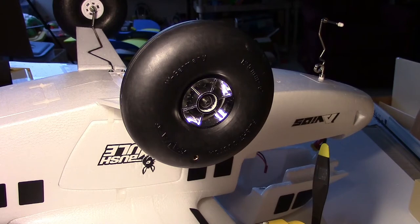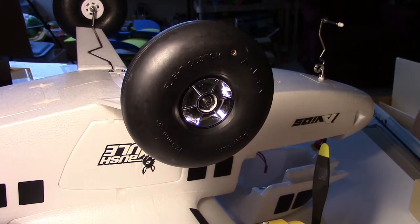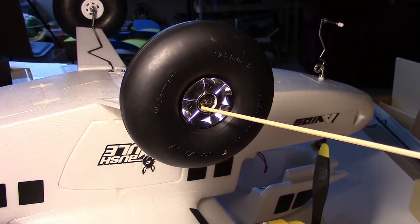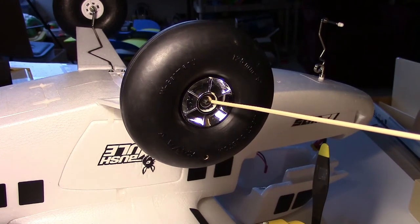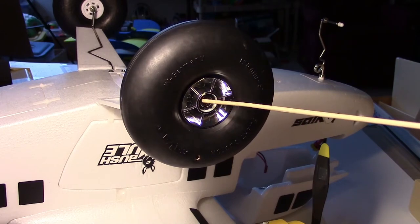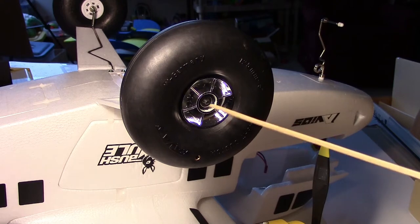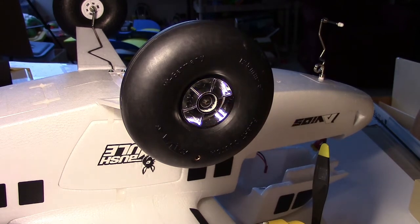Here's one of the five inch Kavan wheels mounted on the Bushmule — they look right smart. It took a little bit of work because I had to make two adaptations. One was sliding this adapter in just a little bit so the shaft would stick out enough to get the clip back on. I have a washer and a clip right here, using the original stock clip to hold the wheel on. I did have to work with the hub to move it in slightly, which required some shaving of the plastic.